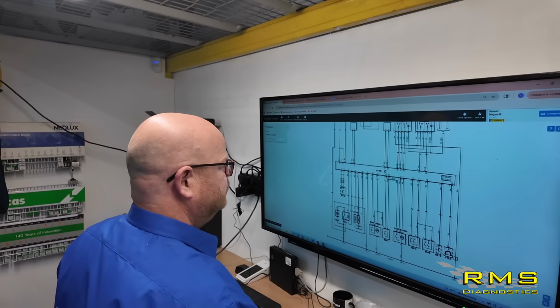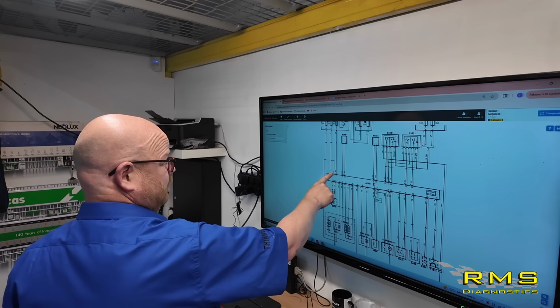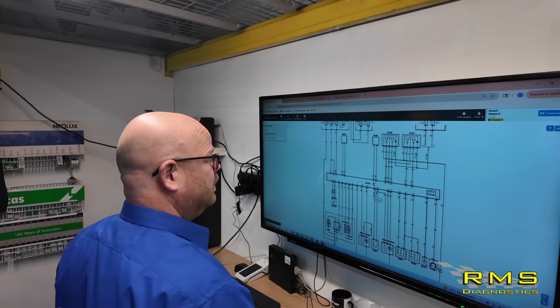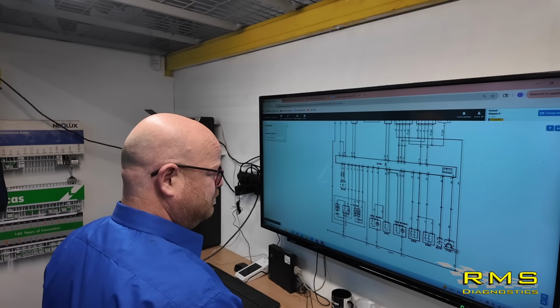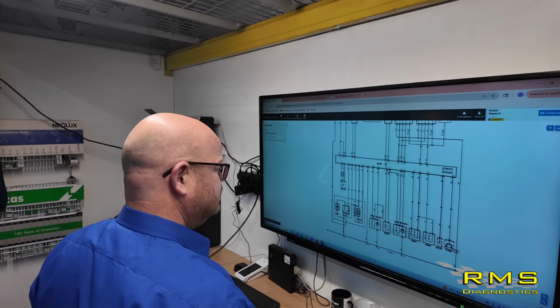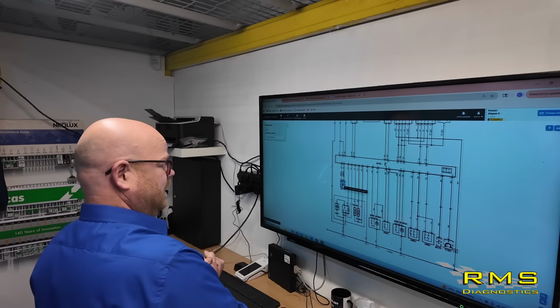So we have got, obviously, we've checked our earth. We've got earth there. We've got a 12 volts here. And we got, well, 11.5 volt here, 11.5 down the switch. And all the other ones are sensors and switches, magnets and rollover bar, rollover bar activation, the motors, all that sort of gear. The communication line goes to pin 13 and 14 and they're CAN bus.